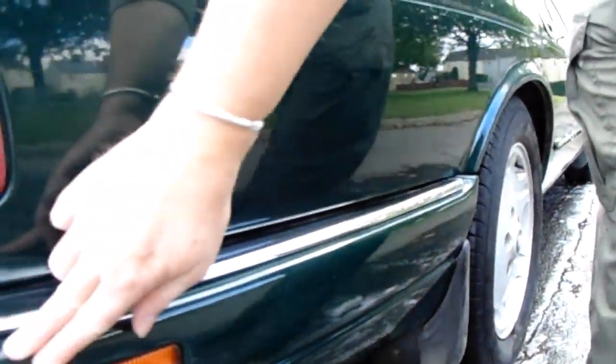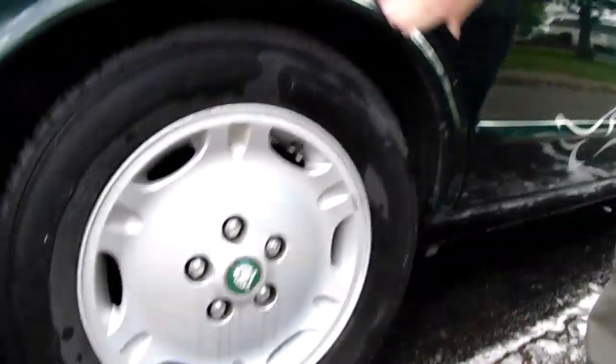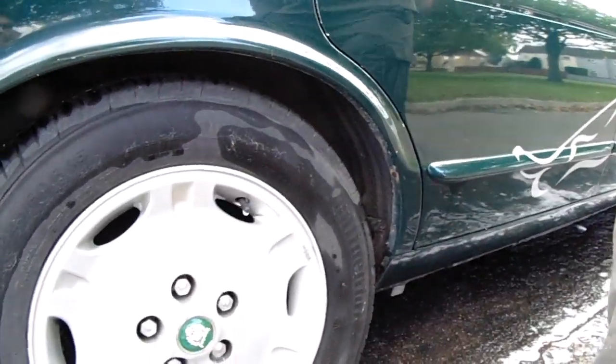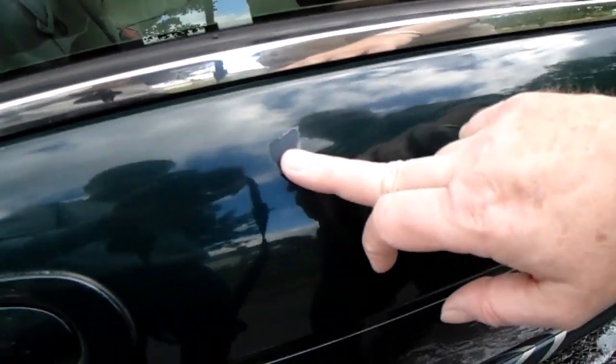And same around this side, it's not too bad. The bumper just needs coming off on there again. This wheel arch ain't too bad. You can see where it's been touched up. You can see where they've tried to blend it, like up there and just there. But this side, it's reasonable. I'm not too worried about that, but I might just get that flattened down a little bit and put a bit of lacquer in there to recover that back up. Just dab it in with a brush or something.